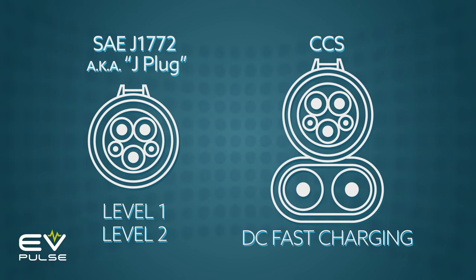Remember when I said almost every EV supports a J-plug? Well, of course we can't talk about connectors without mentioning Tesla's proprietary design, which is everywhere because it's what comes on Tesla vehicles. Elon Musk's configuration looks kind of like the J-plug, but slightly flattened. Because of its unique shape, the Tesla connector only works with Tesla chargers, and unlike other EVs, the same plug shape is used no matter if you're slow charging or fast charging. Adapters are available that allow the Model S and its kinfolk to charge at EVSEs equipped with either J-plug or CCS. And while adapters like this one allow non-Teslas to recharge at Tesla's slow chargers, no such capability exists for fast charging. Elon Musk's proprietary charging port design is one of the reasons you can't juice up other EVs at a Tesla Supercharger, though corporate politics are the biggest hurdle. Someday Elon Musk will open his industry-leading charging network to non-Tesla EVs — someday.